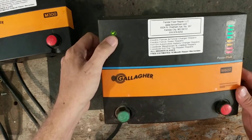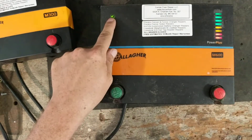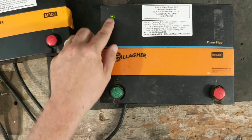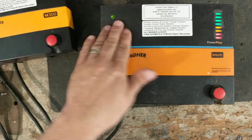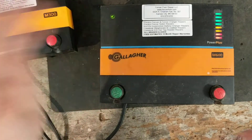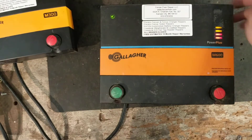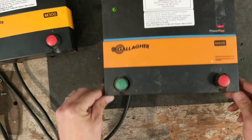This unit has a row of lights and a flash on there, and a little check mark that shows the power is on. Sometimes these bulbs burn out, sometimes they get shifted on the inside and you can't hardly see them, or you get crud behind this front sticker that blocks off that little window. But it's just a power indicator — if it's flashing, you know power is on.